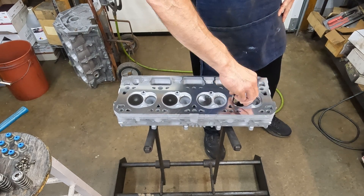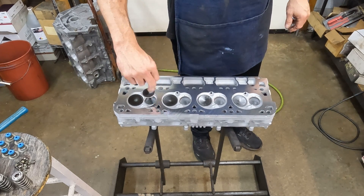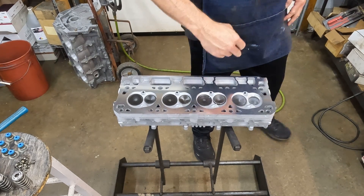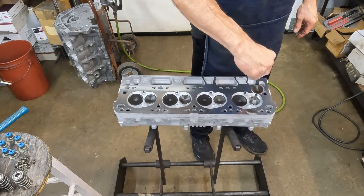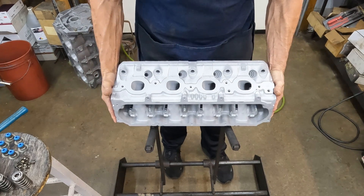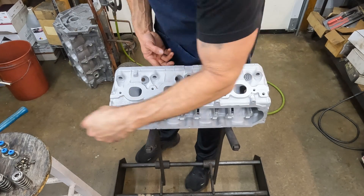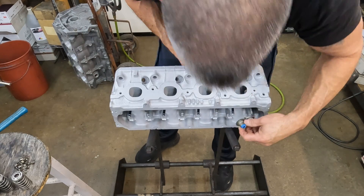Other than that mass of carbon — man, these direct injection engines are horrific about carbon in the ports and on the back of the valves. We tumbled all the valves and they came out like brand new. But there was one that had so much carbon on the back of it and it had gotten so hard that I had to take a wire brush, put it in a drill, spin the valve, and use the wire brush to get all the carbon off. It was so bad. I know direct injection is supposed to be the better deal, but boy, it don't look like it.